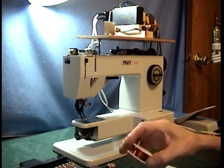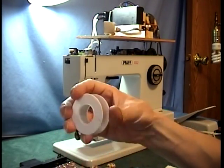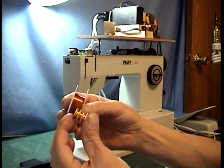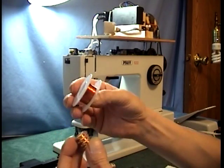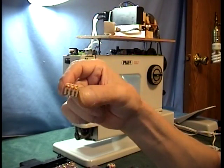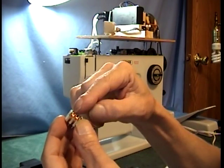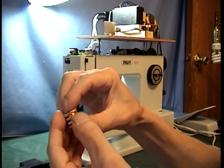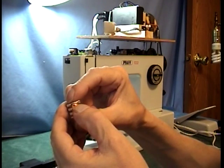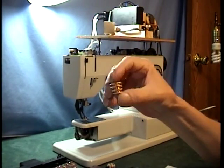What I do is take all the wire off, since it's just a plastic insulator, and I have new magnetic wire of the same diameter. I rewrap the coil with it, which makes it basically brand new, because the only important thing is the coil wire — that its insulation doesn't overheat and wear out, causing a short in the coil.